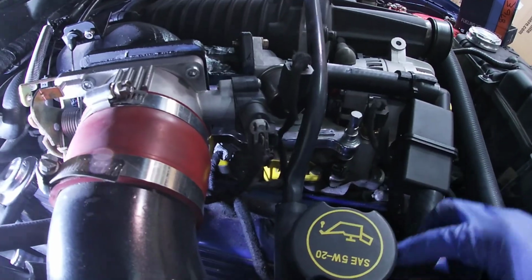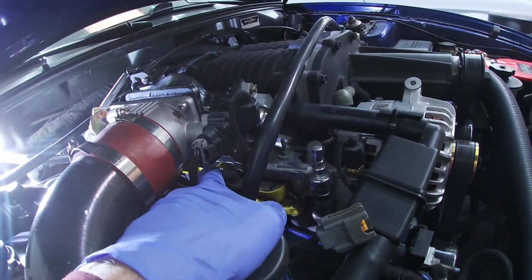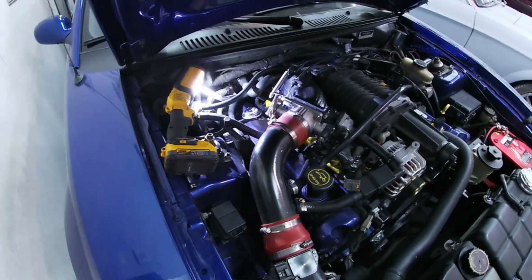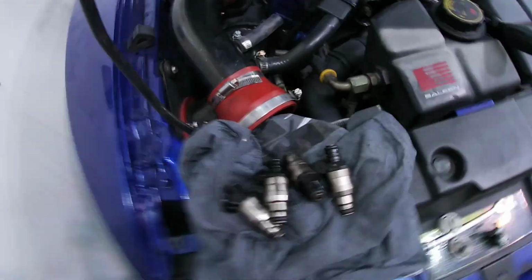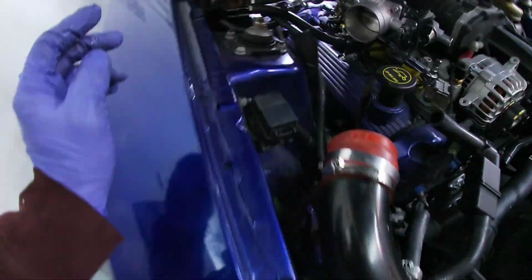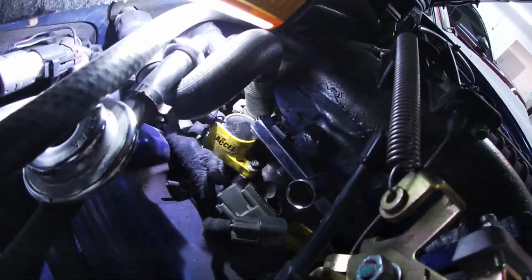Like I said, from what I remember, I put these on there that way. Hopefully I can get the new ones in the same way. So I'm gonna start by unplugging them and then loosening those 2 bolts and try to get them out. Okay, got these 4 injectors out on this side. So apparently that bolt, I don't think it comes all the way out.